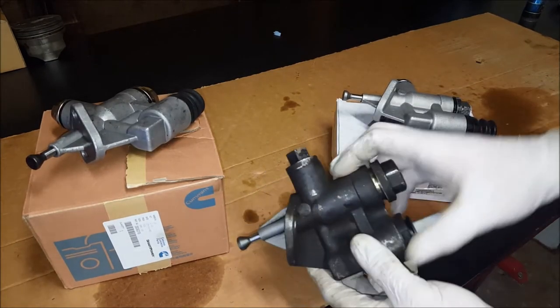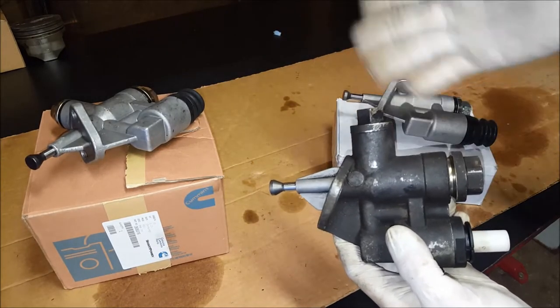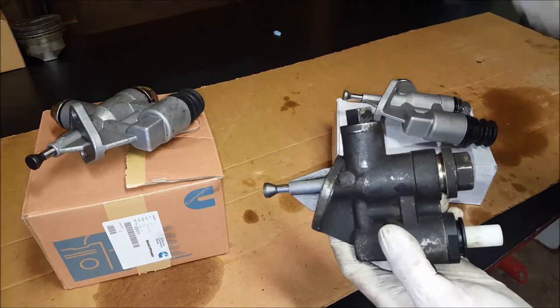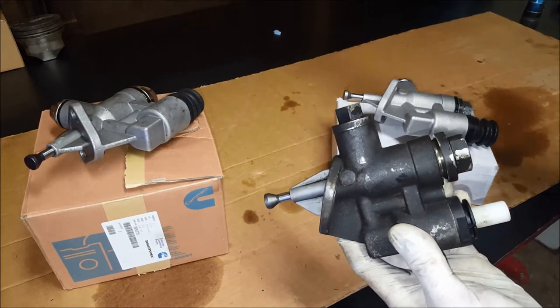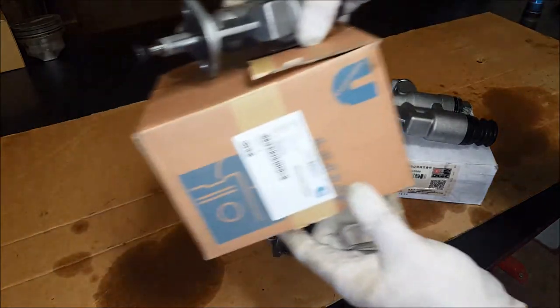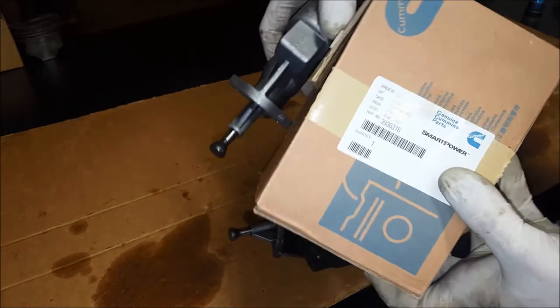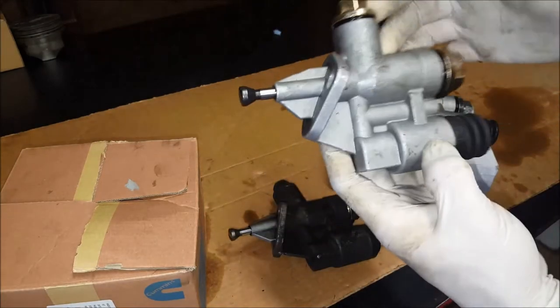Originally I replaced this out of my truck because it was only producing 25 PSI fuel pressure no matter what I did, even with the return line kinked off. I think it's just worn out - 200,000 miles on it - so I replaced it. Went on eBay and I said, instead of the Chinese ones, I'm going to spend the money and get this made-in-USA Cummins one for $69. I get it, it says made in USA on it, seems nice, so I put it right in.